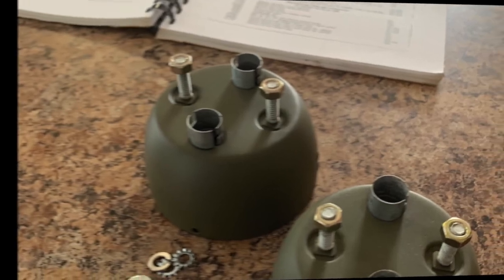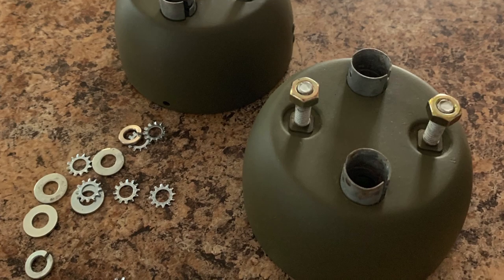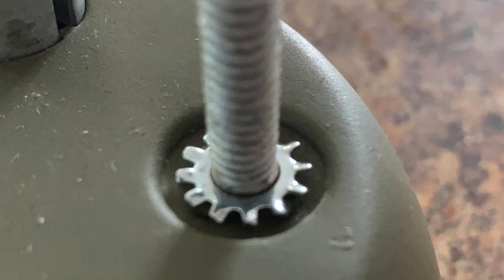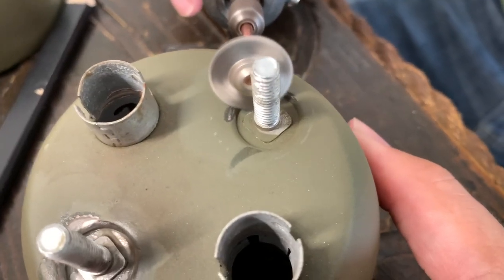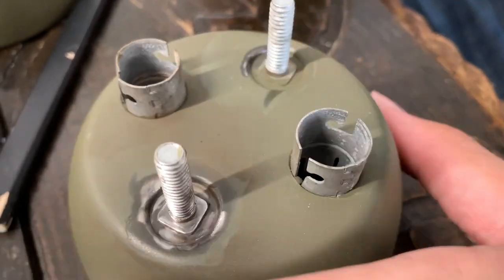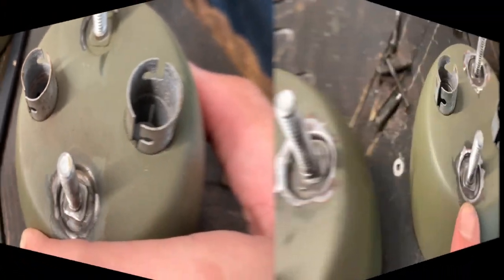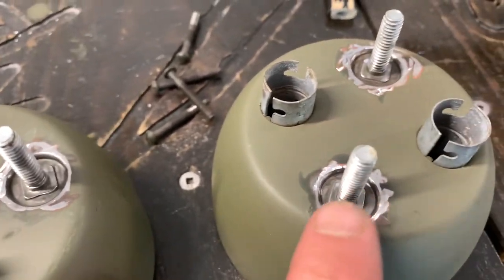It's not really hard, but this is an essential thing. The most important thing is getting those things grounded in the right locations. In looking through the master parts manual, I discovered there was a nut, a lock washer, and an internal and external star washer to be used to install these Corcoran Brown tail lights. My issue was that the star washer I could find locally was falling inside the groove and in no way would make contact with the bracket on the tub, so there would be no ground and no working lights. To remedy that, I took a wire wheel and wire wheeled off all the paint from previously painting them on the post and a little bit on the outside of the housing. That should make a good ground contact area.